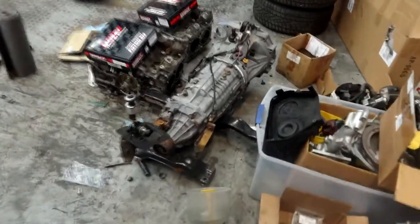All right guys, today we're putting in a 2006 STI transmission into my 06 WRX. It's gonna be quite a process, we're gonna have a fun day. As far as the 06 STI transmission, I'm aware it should just bolt right in - I don't have to change axles or hubs. I'm changing my rear diff to an R160 and my driveshaft to an automatic driveshaft out of an older Impreza. Everything else should just bolt right up.